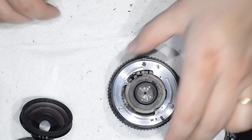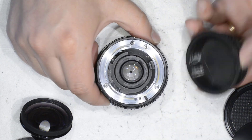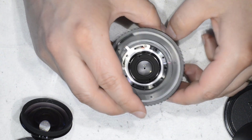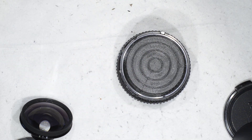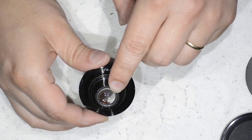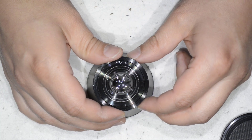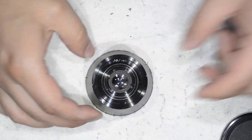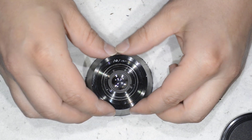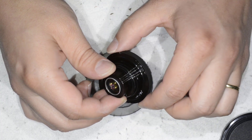Now I'm going to put things back again. I put in the three screws, and I'll keep it upside down so I don't get dust inside. We're going to take care of this front element, which we need to further disassemble because the fungus is just behind this glass. First thing you need to do is come here where you'll find some glue, and we're going to dissolve that glue.